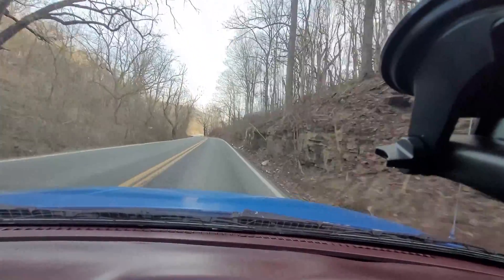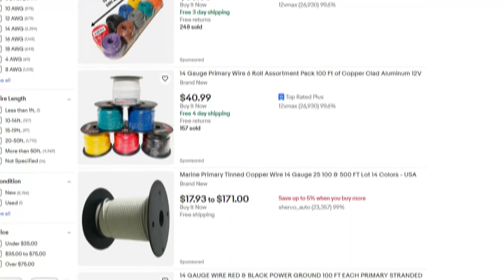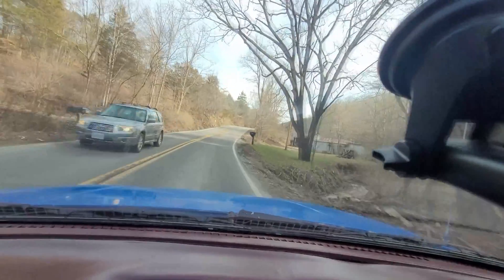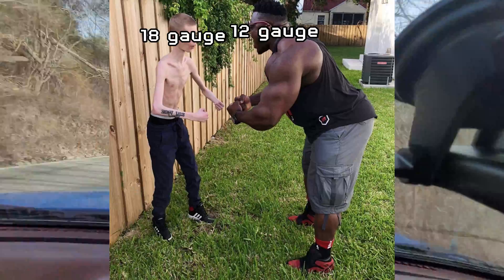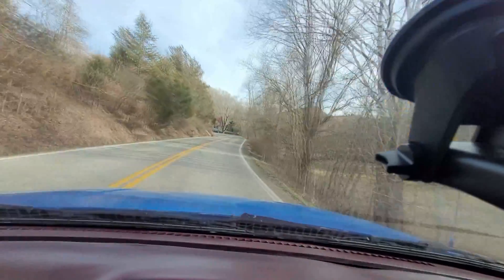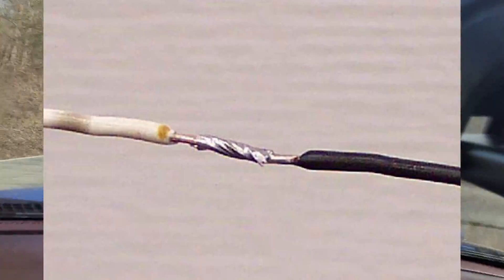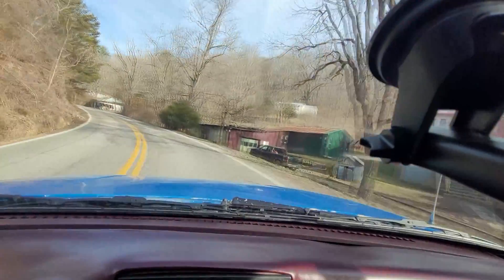To install a standalone ECU, you're going to need a lot of wires. I recommend just going on eBay and buying a spool of 14-gauge multicolor wire. Most of the recommended wire sizes are going to be smaller than 14-gauge, but the general rule is you can use a bigger wire than what's recommended, just not a smaller one. You're going to have to attach a bunch of these wires together — some people like soldering, some people like crimping. I like soldering personally, but crimping works too.